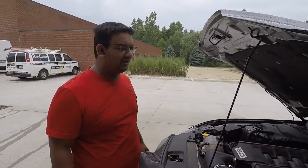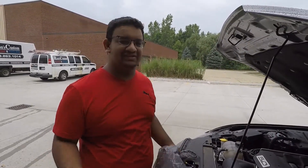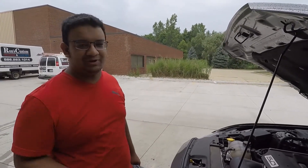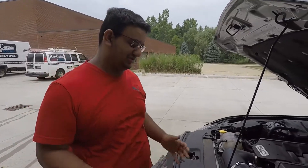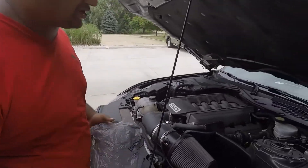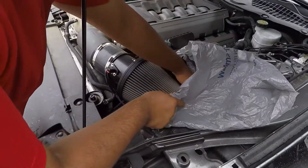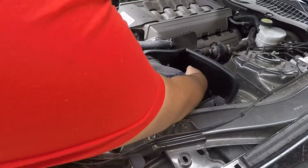With modern engines, everyone tends to freak out when water gets in their engine like it's going to destroy it — no, that's not what happens. These cars are driven on the road daily when it rains, there is water that gets in there. Your car isn't going to die if water touches it. But we do have to cover a few things — with the air intake we do want to take a bag, push it down in there, make sure it goes all the way over it.